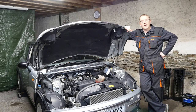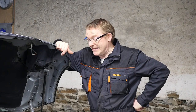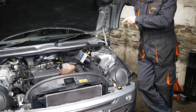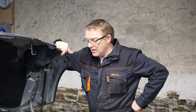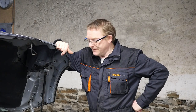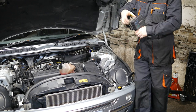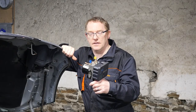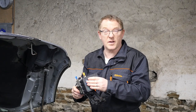Welcome to this video on ABS modules. There are two main manufacturers: Bosch and ATE. This one is the ATE Mark 60, and as people may know from my previous video, I had a 5DF5 error code which means the module is no good. So what I've done is removed it, and my intention is to open this up and see if I can mend it.